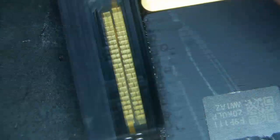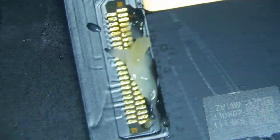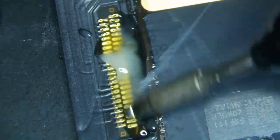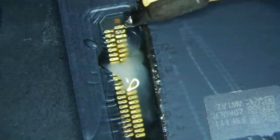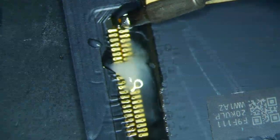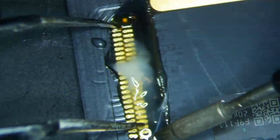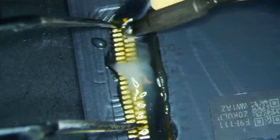Some 8th generation charge ports are interchangeable, so I just buy a bunch of these. I pop some flux on the top side too, then use my JBC C105-113 tip again. You just have to line up these little tabs to make sure things are aligned properly. First I tack one side using tweezers — just that one pin — then come over and realign the other side and do that pin.